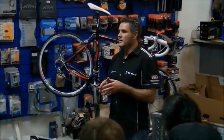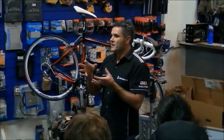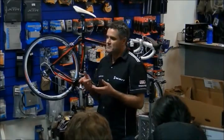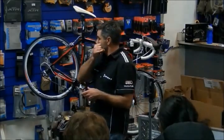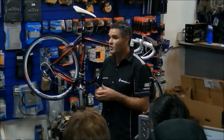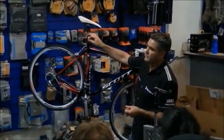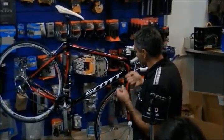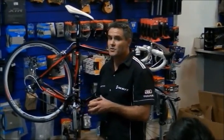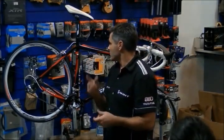With your bike, if you've got a new bike and want to keep it in good condition — relatively clean, well lubricated, so that it runs well — or if you've got an older bike that's been a little neglected, you may need to have it serviced or tuned if the gears aren't working properly. But a good part of it you can do yourself. When cleaning, use minimal water and a mild detergent like a car wash. Get a bucket and a brush or rag, clean it all off, then let the hose just trickle off the soap suds. Never squirt the hose under pressure into working areas, because water under pressure gets into bearing surfaces where it's not meant to be — water and grease don't go well together, it rusts and really ruins your bike.